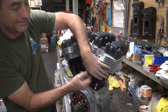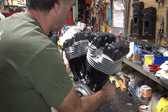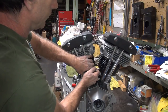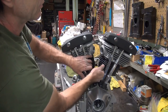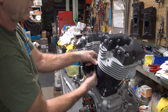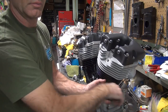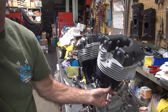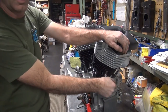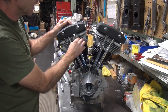Now this head bolt's loose. Torque on that one. Go over here and get this one, get this one — third leg of the triangle, then the two side ones, then the back one here. They're loose, they're loose — perfect.